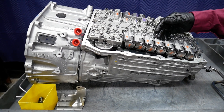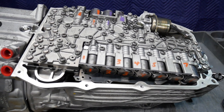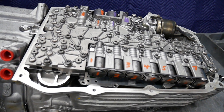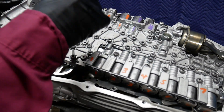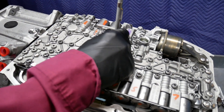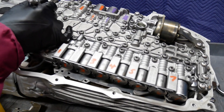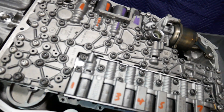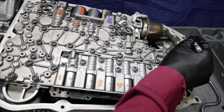There are the two pump pickups, and here we see the associated solenoids — one, two, three, four, five, six. One nice trick when working on the 9G-Tronic: any bolt going into the aluminum-magnesium case is going to be aluminum. So when I get ready to remove the valve body, any bolt that is a steel bolt is definitely not going into the case.